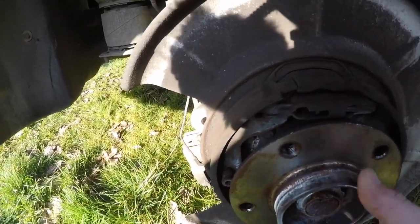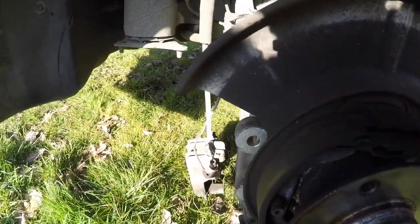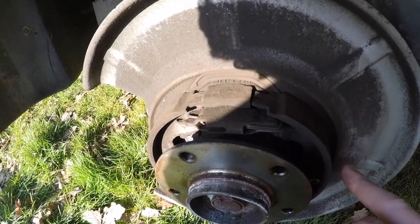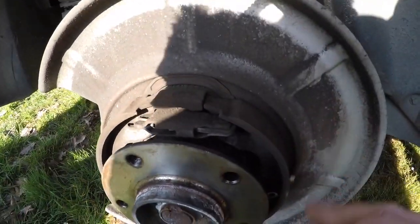Here are the brake shoes. Now we're going to put the new disc on and readjust the brake shoes because my handbrake is doing more than four clicks and isn't sitting properly. I need this sorted for the MOT — it needs to be readjusted to the correct level otherwise it will fail on the maximum efficiency threshold.